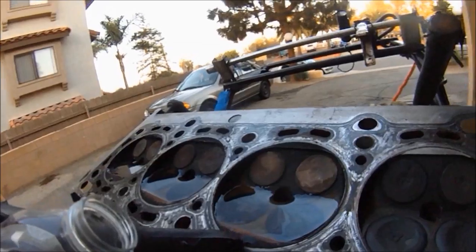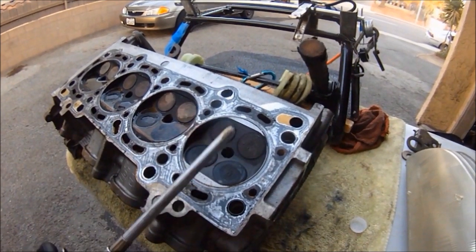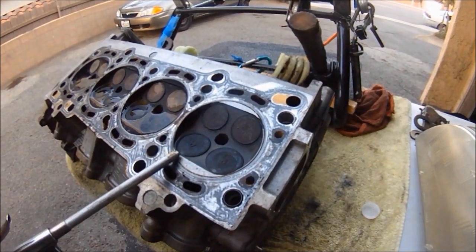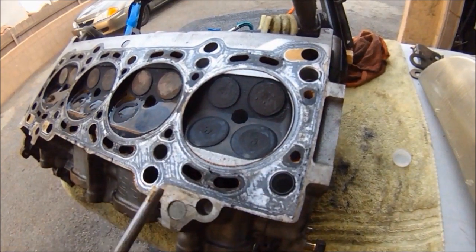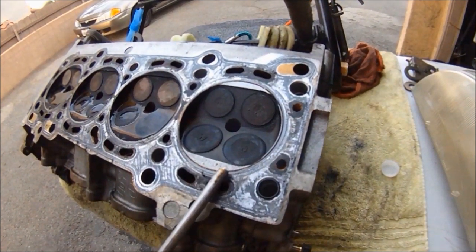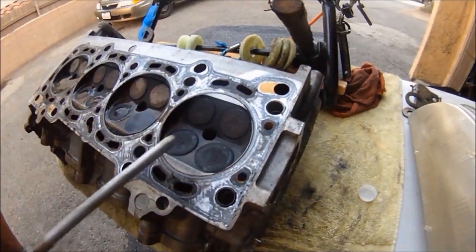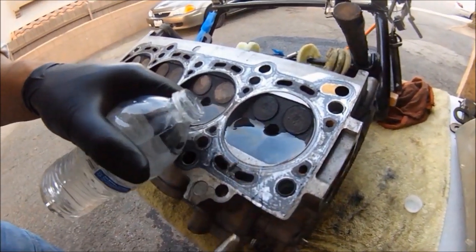Now these are the valves that hit the piston — these two right here. Look at these marks — mark there, mark there — because these are the ones that hit the piston. I only see one mark on the piston, but if you look real close you can see where it hit and some of the carbon is knocked off in that same area. It looks like it tapped it one time and that was it. It seems like the connecting rod broke, the piston got pushed to the top, the valve hit it, then the piston stayed right there. When I took this off, I pushed the piston down with a screwdriver and it just went straight down. The piston was at the very top.